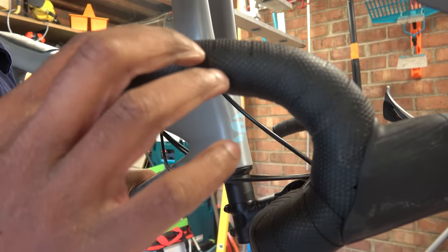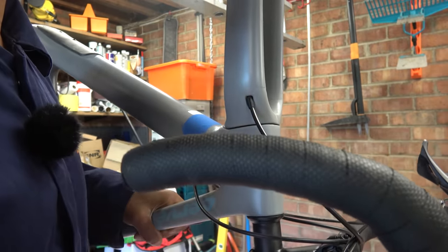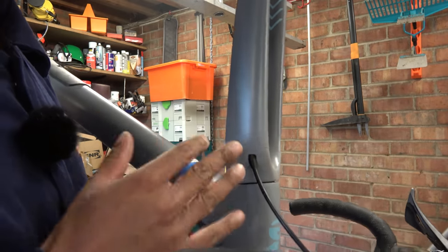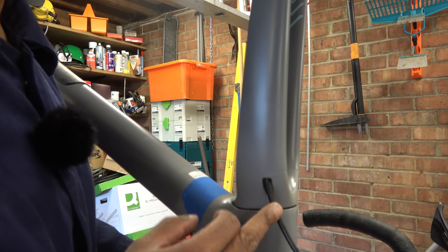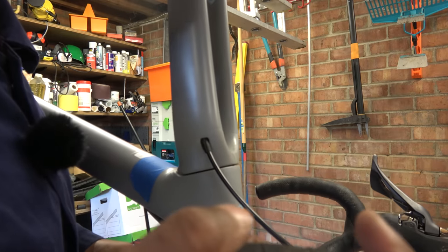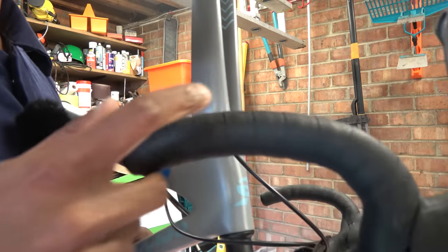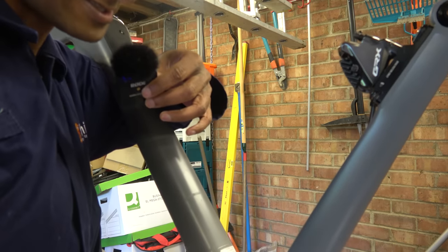Before I go any further — this bike has done 64km, 40 miles. One thing I did notice, and it wasn't really part of the job scope, is the front. I'm not sure if something is wobbling inside, as in the brake hose is touching, or if the bearings are actually shot. More inclined to think there's something wrong with the bearings, but this does make quite a noise — it sounds like something's loose. I'm going to do that again with the mic right close to the headset.